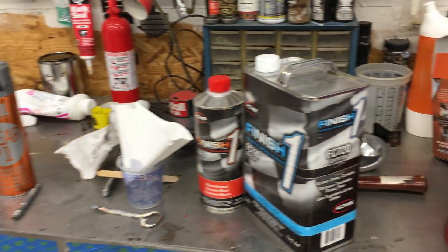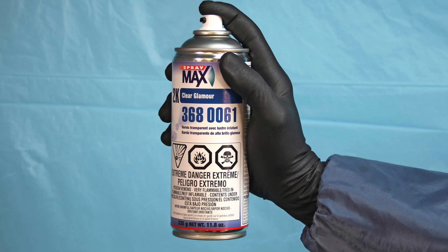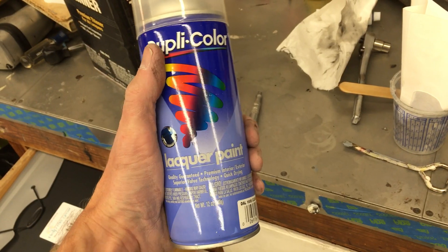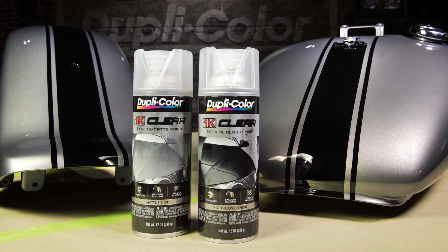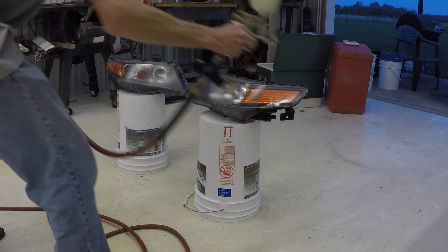But if you don't have a compressor or a spray gun, you can buy a 2K clear in an aerosol can. Spraymax is a good brand — I'll put a link to that in the description. It's actually a step above the u-pole. This lacquer clear coat will not hold up to UV rays. However, Duplicolor now sells a 1K clear in aerosol which is UV resistant, so I'll add a link for that as well to give you options if you don't have a compressor and a spray gun.